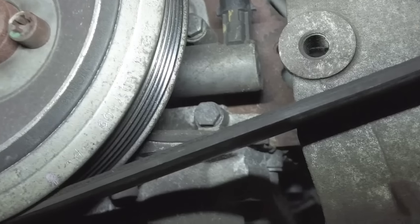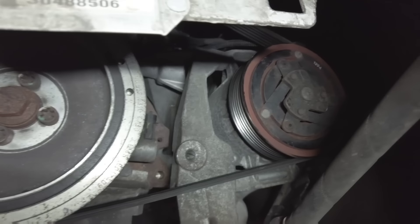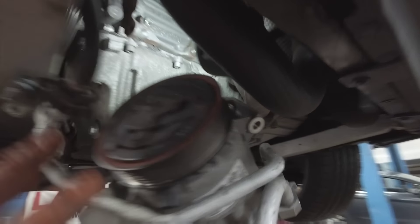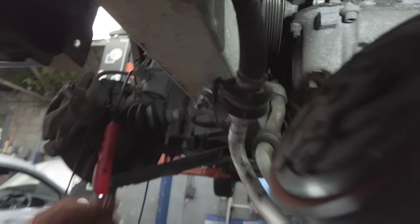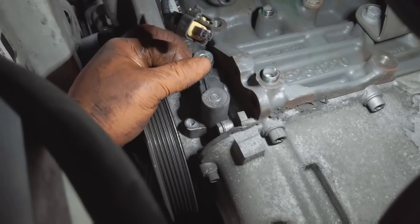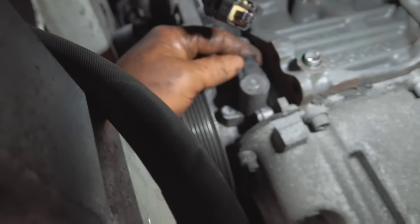So we do need to get it off. Even though it's right by there, we do need to make a little bit of room for ourselves — we'll have to remove the air conditioning pump and the bracket that the pump goes on to in order to slide it out. I've gone ahead and removed the AC pump and bracket. The solenoid is right by there — remove the T20 and give it a little wiggle.